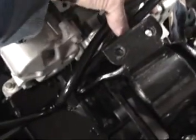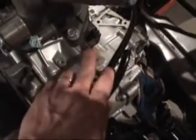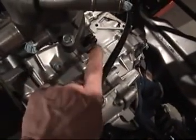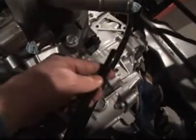One tube will go in front of the other. This one will go into the fuel pressure regulator, which we mounted right here onto this stud. So I'm going to go ahead and make this bracket, mount the regulator and get it in the right direction, and then cut this tube to fit up to it.